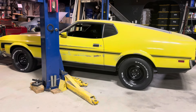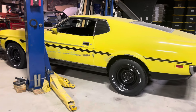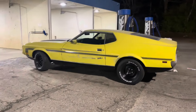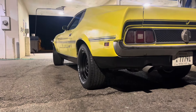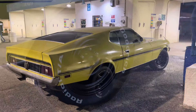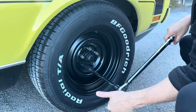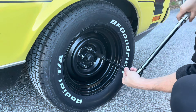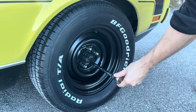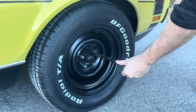I don't know about you, but I think it looks great with those wheels and tires on it. I think I like it a little bit better than the hubcaps. Yellow and black — it looks like a big DeWalt tool. Let's take it for a ride. We made it to the local car wash and man, this thing rides great. It looks good, it rides good, the tires look nice and meaty on there. It does pop a little because of that cracked frame. When you torque down your lug nuts, it's important that for every inch of extension on your torque wrench, you extrapolate the proper torsional flex and add one sixth of a percent per inch. I'm just kidding — just torque them down to about a hundred foot-pounds or so, you can't be too far off with that.